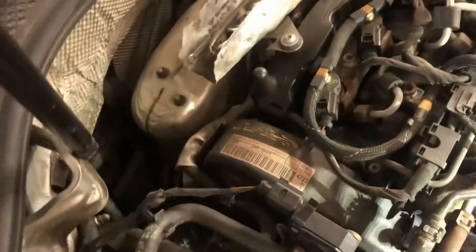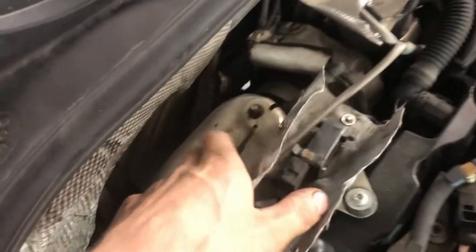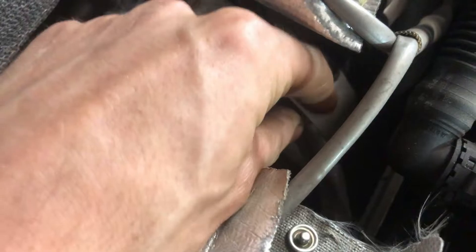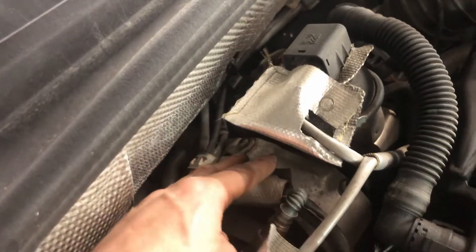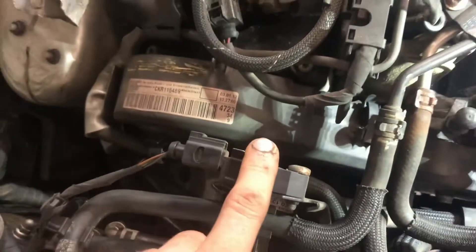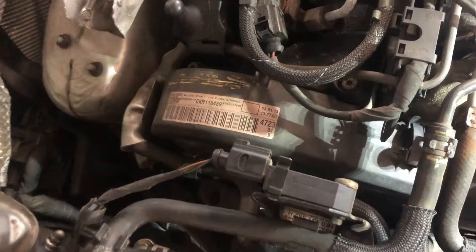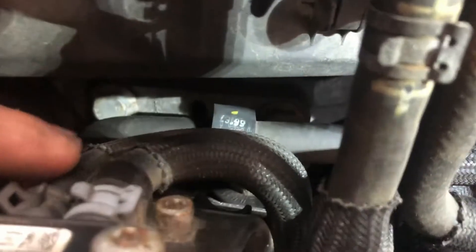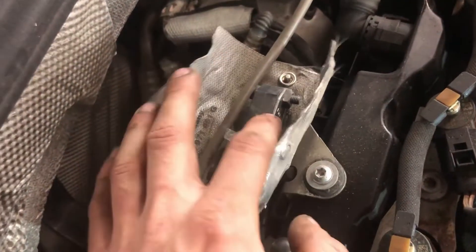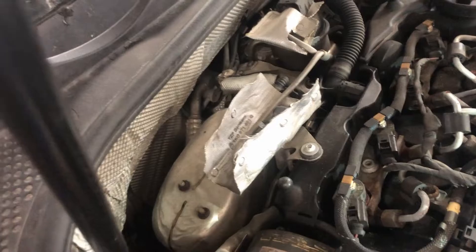We're going to go over a couple of sensors while we're up here. This is your DPF here. You've got your lambda sensor and two EGT probes that go over to the far side. We're going to unplug those and take them all together. We also have our DPF differential sensor, which basically tells the ECU how plugged it is or makes sure it's not hollowed out. The rubber lines go over to here and then switch to steel where they go into the DPF and also up to this sensor, which then goes down to the bottom side.